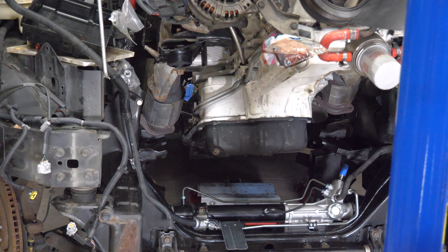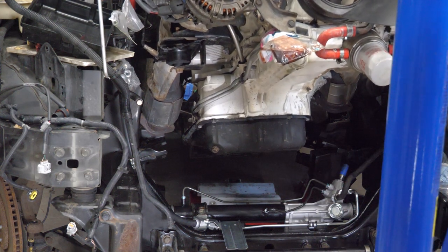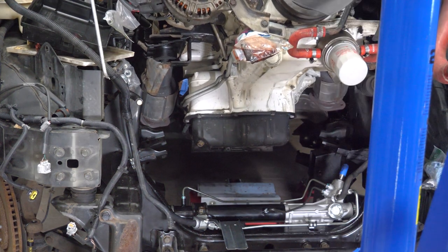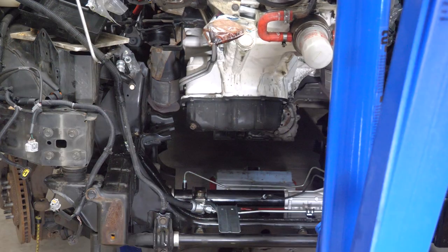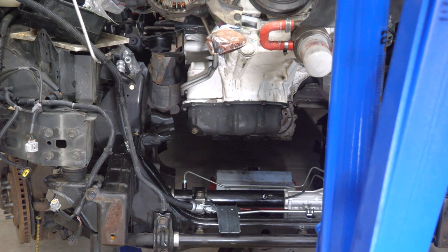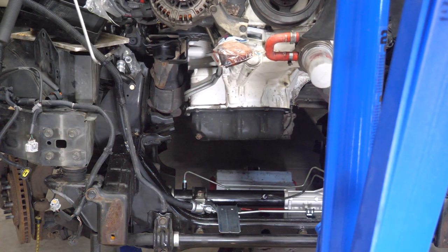The right side — I got five inches over here, so I certainly don't need that space, but it's still free-floating, meaning it's not hitting the transmission tunnel. See if I can lift it over. I think I just did. Once that's over, you can start going down. I think the whole thing needs to come this way. More adjustment — I'm going to bring it forward more and then actually drop it just a smidgen. I have about an inch, I can drop it. Excellent. So far, so good — still free-floating.